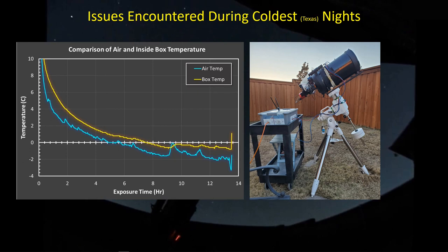I have reported on some of the issues I had with the cold weather when I first encountered these problems, but I'll make this a one-stop shop for thermal issues related to mini PCs. This is an example of the test setup I was using during the winter galaxy season - I had my Celestron C925 out. Down here you can see a little temperature sensor, a data logger hanging off the back end of the altitude adjustment bolt. I've got another one inside the box where the mini PC is, along with a Wi-Fi antenna for better connectivity back to the house. I use remote desktop to tie into this computer through that antenna. I'll be measuring the air temperature, shown in blue, and the box temperature, which is inside the box adjacent to the PC and just under the USB cables.